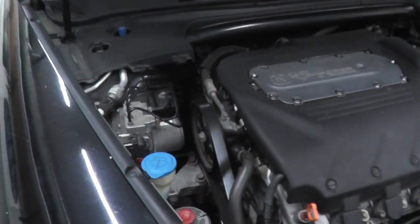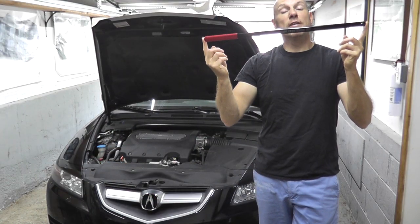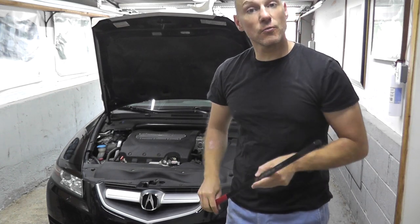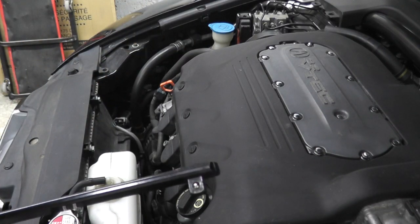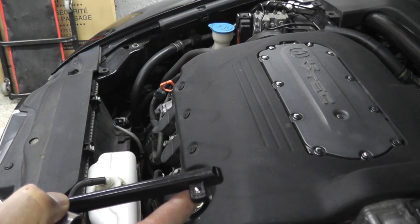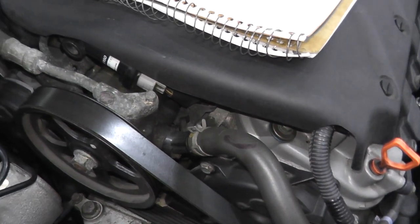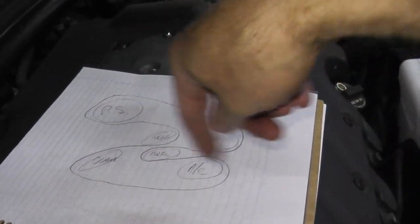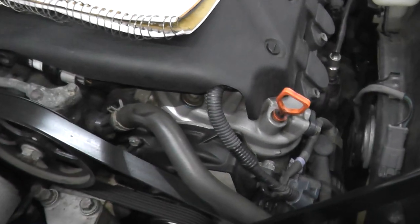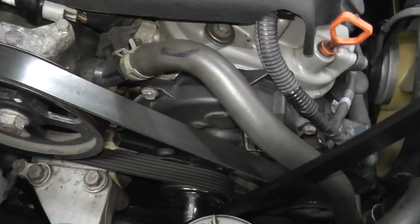Now if you're not sure, the next step is removing the drive belt and starting the vehicle. I have a belt removal tool — as always, I'll list all of the tools in the description box below. If you're not familiar with this type of tool, it makes removing the belt really easy. It uses a 3/8 drive adapter; in my case it's a 14mm socket. Place the tool directly on the tensioner. Before removing the belt, I've given myself a little diagram showing how the belt routes. Take some pictures, do a diagram, then simply place pressure — you see how the tensioner moves? — and that's how you remove the belt.